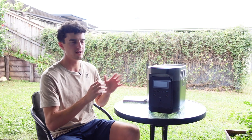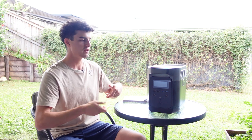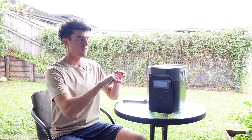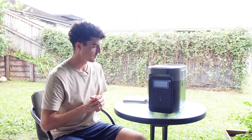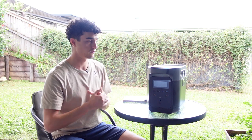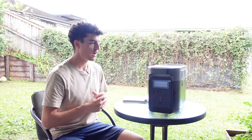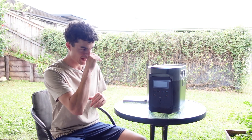How do I use this exactly? Very simply, I store it on the back seat, then when I arrive at camp I put it in the tub with the tailgate down, unplug my fridge from the dual battery Anderson plug running to the 45Ah under the bonnet, and plug the fridge straight into the EcoFlow. When I want to move camp, I unplug the fridge, plug back into the dual battery, and this goes back on the back seat.